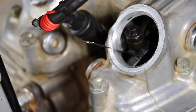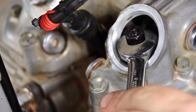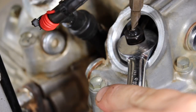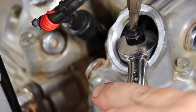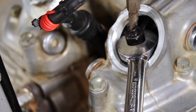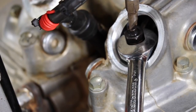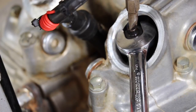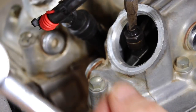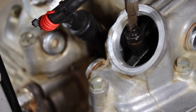Now if these were not perfect — if they were too tight — I could take my wrench, crack it open, put a screwdriver right here, and turn it counterclockwise to loosen it up, then hold it in place and crank it back down. Now if they are too loose, crank it open, turn this clockwise and screw down until it touches the feeler gauge, hold the screwdriver in place, then crank the nut back down. Then check it with your feeler gauge — make sure there's just a little bit of drag but it's not pinching the feeler gauge.